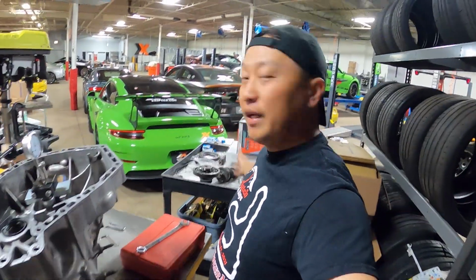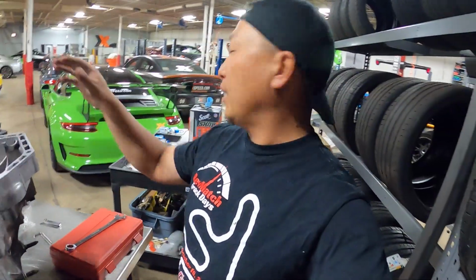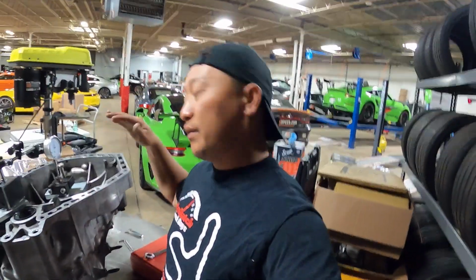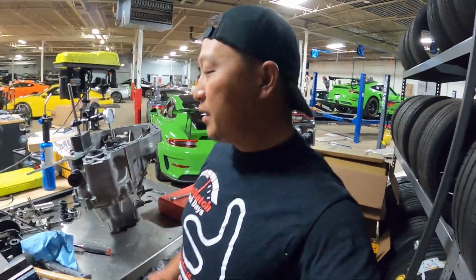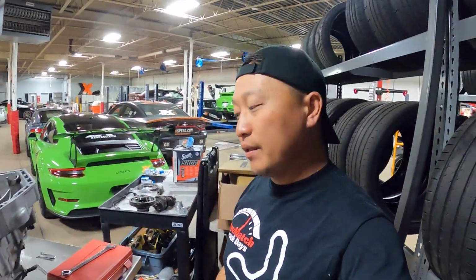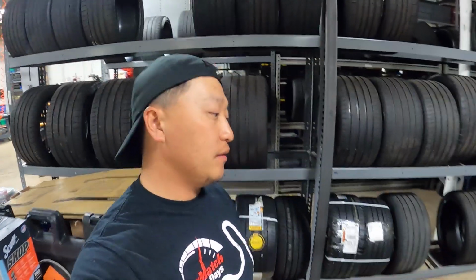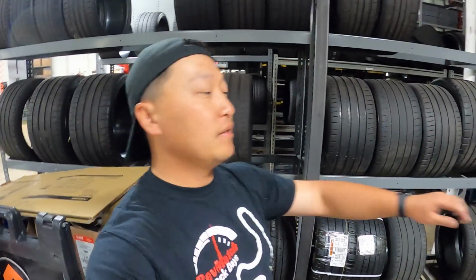We've got, you know, the main shaft put together, the counter shaft, we got our diff. Our shim clearance for the diff is good, but the main shaft thrust clearance is not good, so we got to get a new shim for that. 3 and 4 shift fork is bad, so we're waiting on one of those. Once I have everything in hand, I'll go ahead and assemble everything, put this thing together, and then we should be good. So we're making some good progress on the Civic. Hopefully we can get this thing done soon.